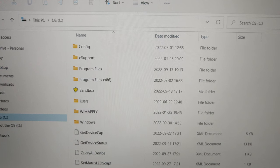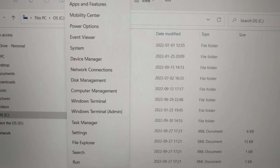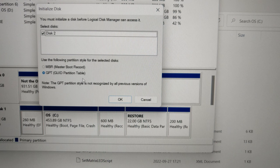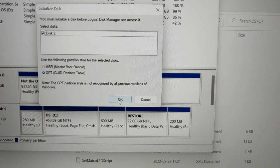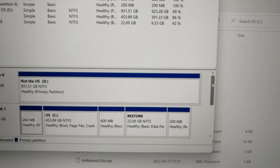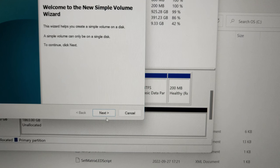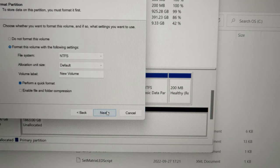As you can see, it's not immediately recognized. That's probably because we've got to do a little disk work on it. Let's go to disk management. It has to initialize the disk, it says. And there we are — two terabytes of unallocated space. Format it, create a new simple volume, and use the defaults for now.